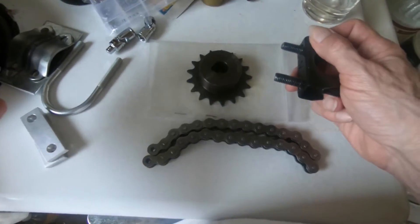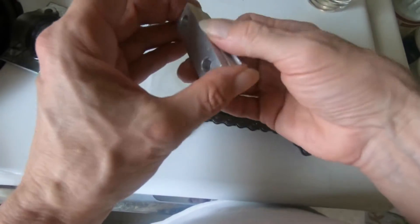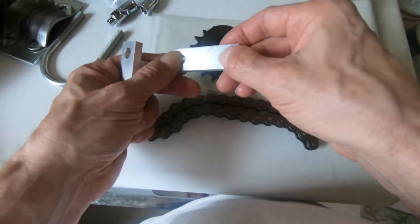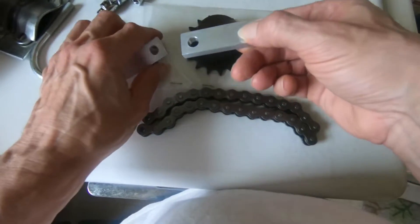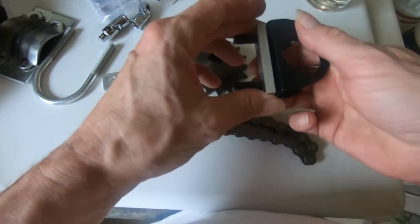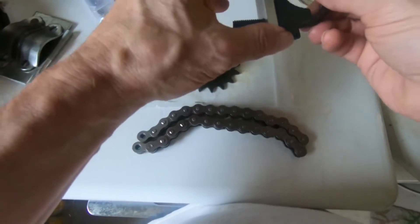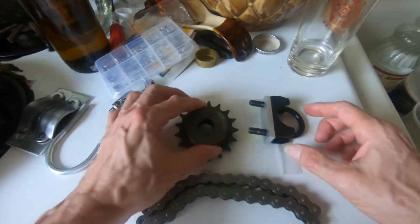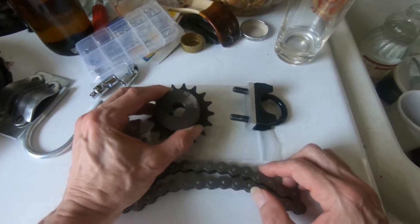By examining his video I determined that I could make some quarter-inch spacers. I bought some 6061 aluminum bar, cut them to length with a hacksaw, and had my stepfather drill the holes since my drill died. With these spacers in front of each of the three clamps — the chain tensioner clamp, the clamp on the bottom of the shift kit housing, and the clamp on the top — it moves the gear a quarter inch more away from the rear tire, giving me enough safer clearance.